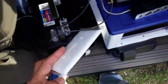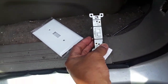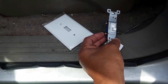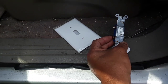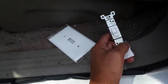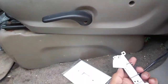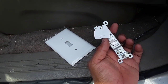This little switch I bought is a household switch. People experienced with this say you should use a 12 volt DC switch rated at 20 or 30 amps, which I did try but it melted. So I'm going to use this household switch — it's rated at 15 amps, 120 volts AC only. But it's the same one I used in Little Blue 2 and it had no problems, so I'm going to use it again.